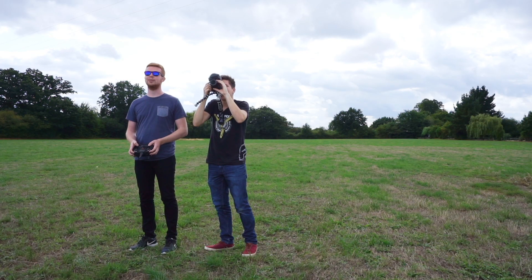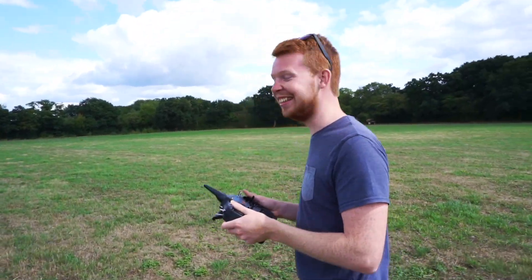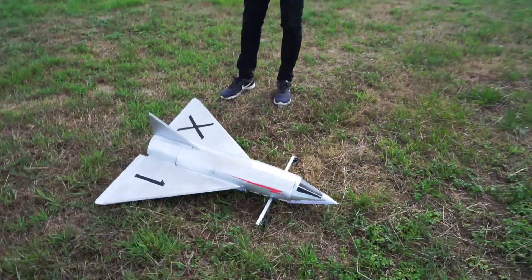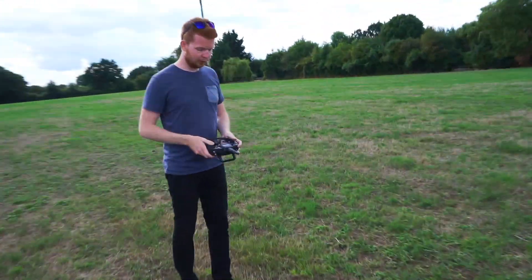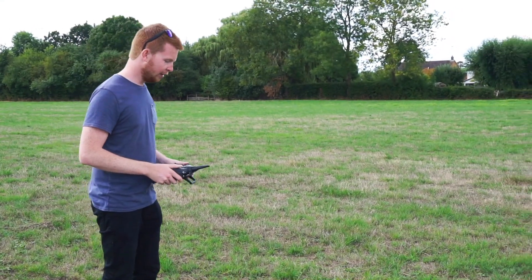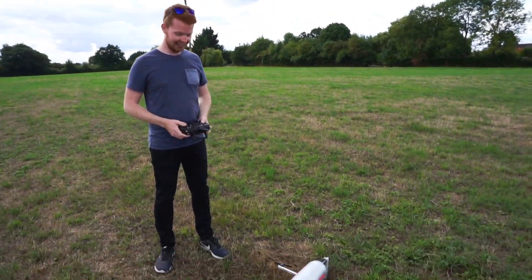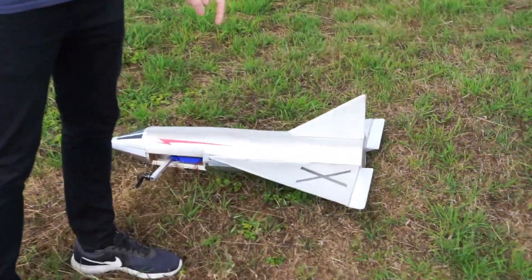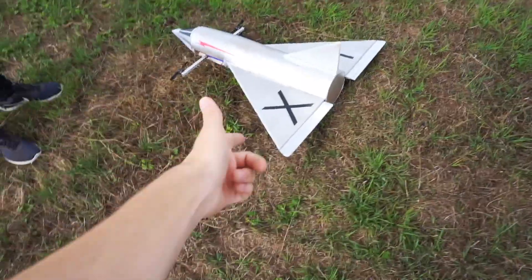See if it goes vertical - not quite! How was that to fly? Actually quite nice. We need to put some larger propellers on it - it either needed more battery or larger propellers, because it needed quite a lot of thrust. In terms of the actual flight characteristics, it's really predictable. When you fly at low speed the elevons don't need to do a whole lot because the motors just pull the nose up - the motor actually does the work. I reckon we could land it on motors alone.